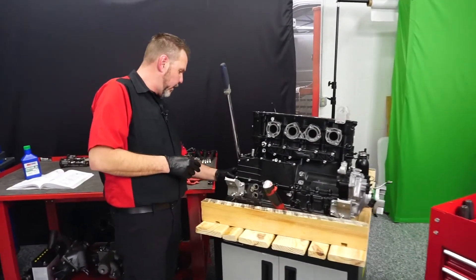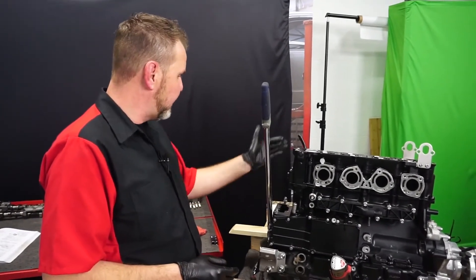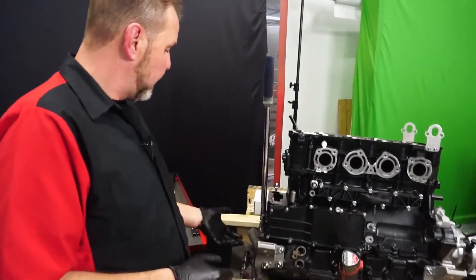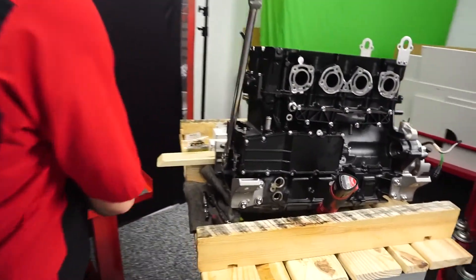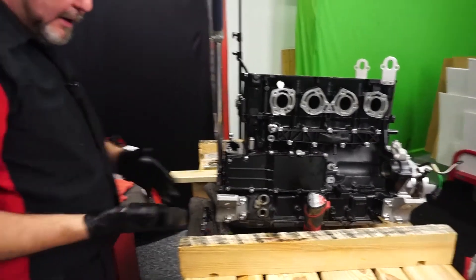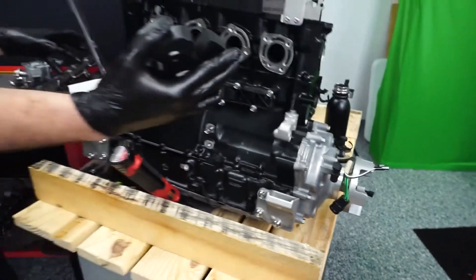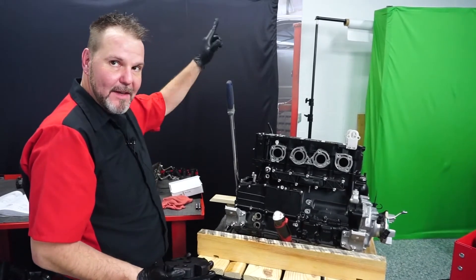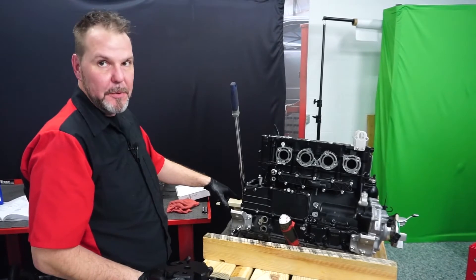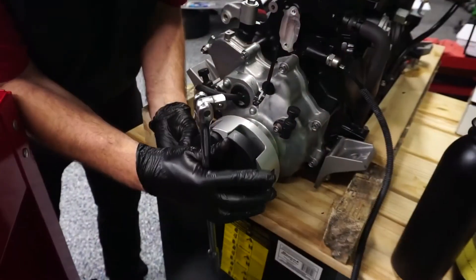I want to remove the drive gear down here where the oil pump was mounted. There is also a timing chain guide in here — I'd like to remove it before I lift the cylinder head out. Now when you're removing this, you're going to have to hold the crankshaft on the other side with a special tool provided to us from SBT. This is what you're going to use to hold that drive coupler on one side and then remove it with the other. Yamaha says to turn this clockwise, so that means if you're trying to loosen this bolt, it's reverse thread.